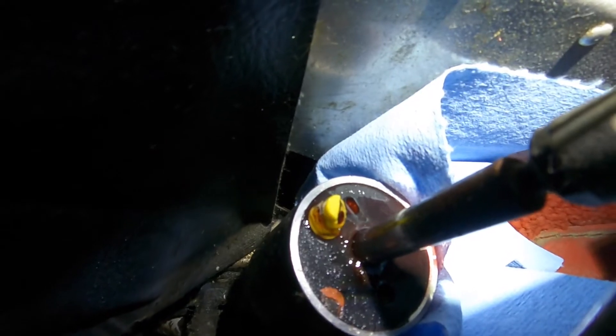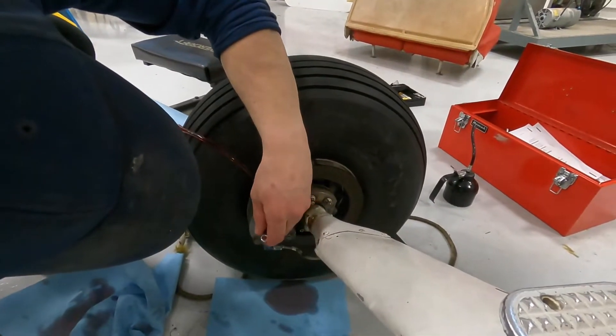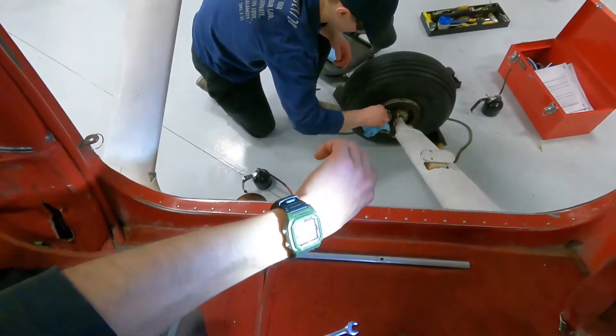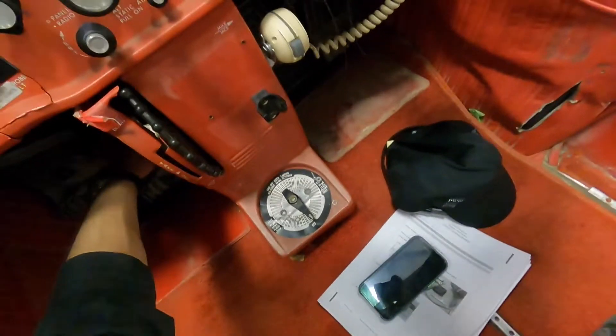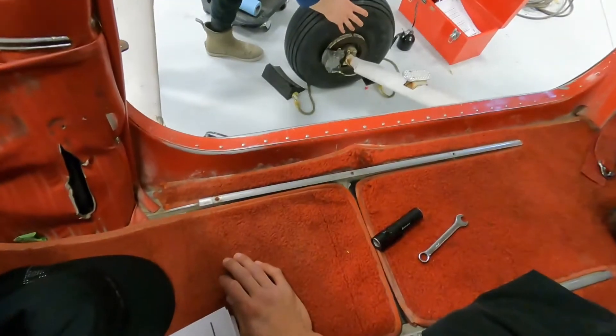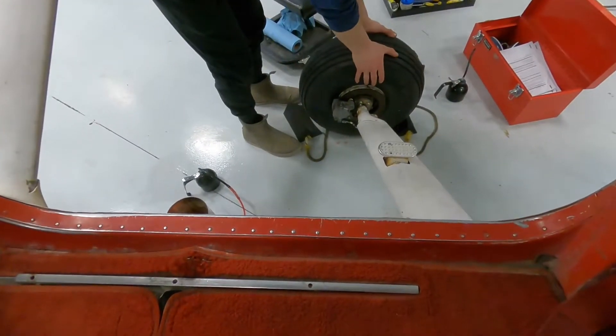Keep pumping as you close it. Alright, so we had some positive filling — air bubbles should be out. I closed it. Tyler is a power lifter and he's trying to move against my hand against his master cylinder. It's a good test.